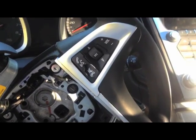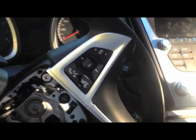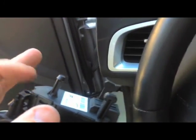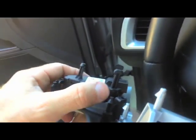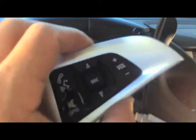I'm back in the car now. Hopefully that helped you see a little better what I'm talking about with the angles. What I've done here is I've disconnected all the trim, and both my buttons stayed in. What I'm going to do is flip this thing over — there are two screws right behind this button, one right here and then one over on the other side. I'm going to pull those screws out — I've already done that — and that way I can take this trim piece right here completely off. Now it's going to make it easier for me to pop these tabs loose.